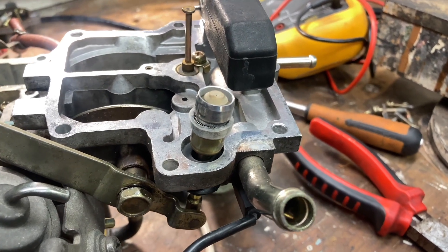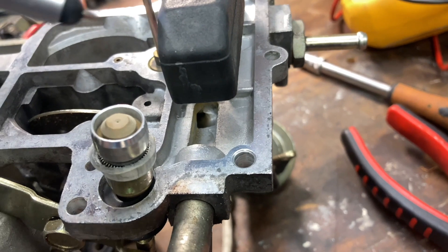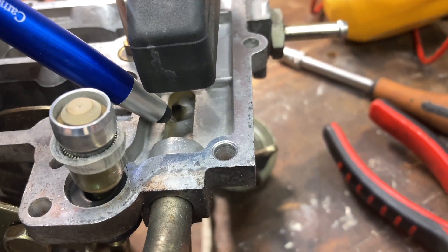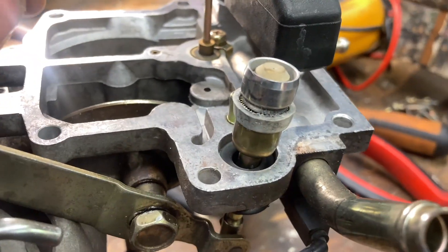This is the underside of our carburetor top. As you can see here, this is our float bowl vent, which basically vents right on top of the float — so any fuel vapors that need to evaporate will come out of here rather than spill down into these two venturis here and flood the engine.